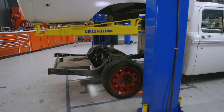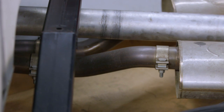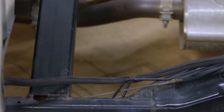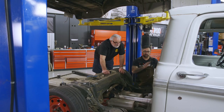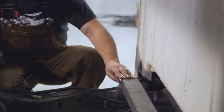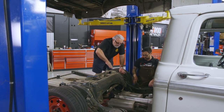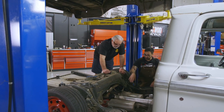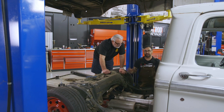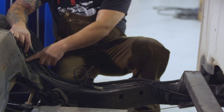Here is the deal. We've got a bunch of giant braces that we made to support both the cab and the bed on this frame, but they're all going this way — big factory support this way, cab support, bed support. What we don't have is anything in this direction. Because the suspension pickup points are right here, we're getting a lot of flex, so we're going to throw a couple of bars forward to tie it all together in this plane and hopefully stop the entire thing from bending.